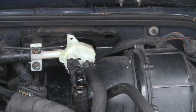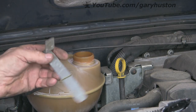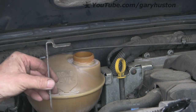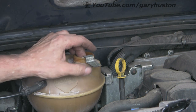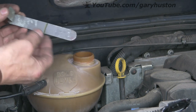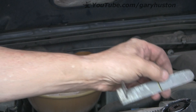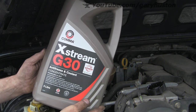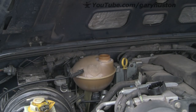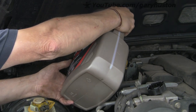So I'm just going to top up what we've lost, which I don't think is a massive amount. My little stick — that line just hooks over the cap lip, and that line represents the coolant level line because you can never see how deep it is. You can see it's about three quarters of an inch down. I use coolant concentrate neat — no water at all.